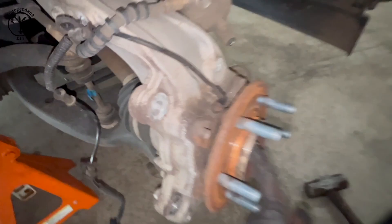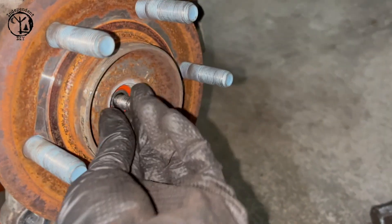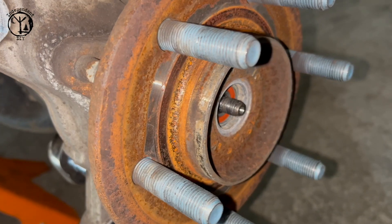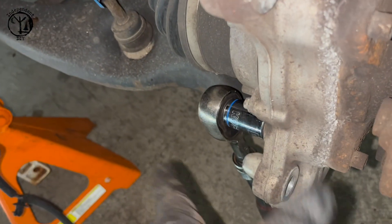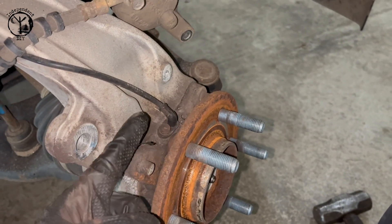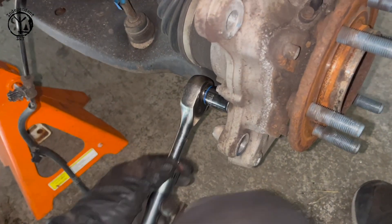You can see there's a fine little bit of Minnesota rust on here. It's kind of comical that Ford F-150 trucks have the smallest lock nut known to man - that's a 13mm. These back bolts are a little beefier, they're 18mm, and there are four of them - two on this side and two on the back side. It helps if you can turn the steering wheel back and forth to give yourself easier access to the bolts.